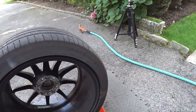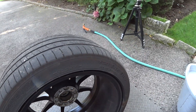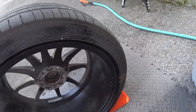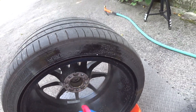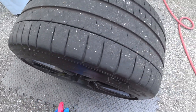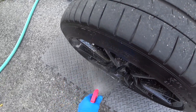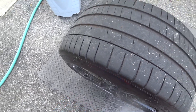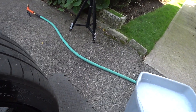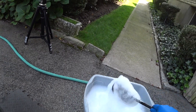Now the wheel is set up on the foam square. This is the Malco Red Thunder - I liberally spray it down. I've been using this product for about 20 years. You may not be able to find it online, but I recommend it over Simple Green, Grease Lightning, or 409. You don't really have to agitate it right away. I have a bucket here with some Red Thunder very lightly diluted and I've got the wheel woolies, so here we go.